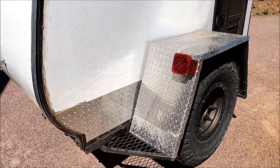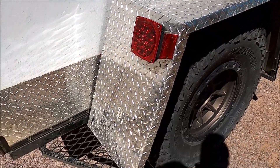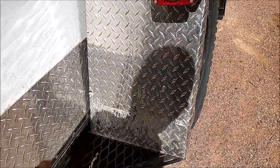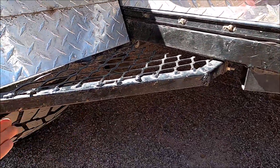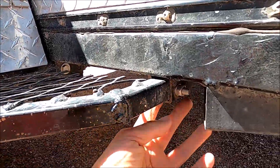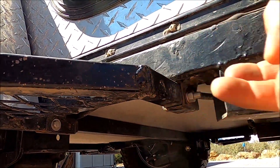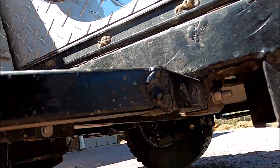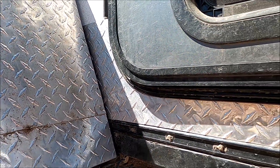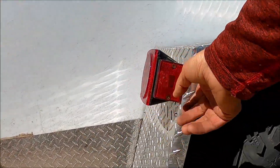Another challenge was creating the fender for this giant tire. I ended up cutting and remaking the fender three times. What I eventually did was, instead of welding the fender directly onto the frame, I welded square tubing pieces onto the frame to serve as sleeves. I can then slide the fender into the sleeves and drill some holes — so the fender is actually removable. This makes life easier when installing the cabin, and also when servicing the axle or tires.